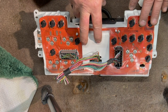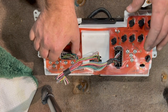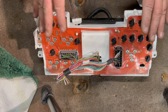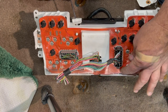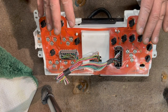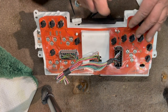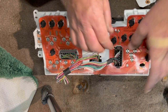The center plug is the one that goes into your PSOM. Ideally you should just be able to squeeze the tabs and pull straight out, but some of these haven't been removed in the past 25 to 26 years, so they're a little sticky. These printed circuit boards get a little wonky and you don't want to tear them — it's all old, it's all brittle. So let's start with the vertical clip: squeeze it and kind of wiggle it back and forth.